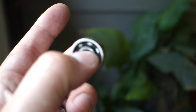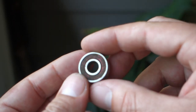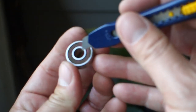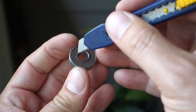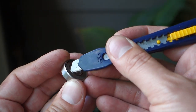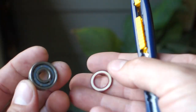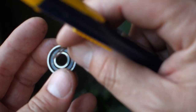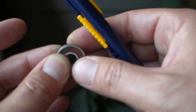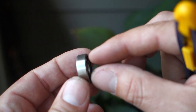They sound good because I regularly maintain them — I've occasionally pulled the race out and cleaned under the shield. An interesting trick you can do with these bearings: you can take the dust shield and swap it to the other side. I've done that on these. Since I was trying to keep them as clean as possible, rather than having the shield on the inner side, I put it facing the axle nut, creating a kind of double wall. Then the open side faces the inside of the wheel, with the urethane in the middle acting as another guard. It works really well — give it a shot.